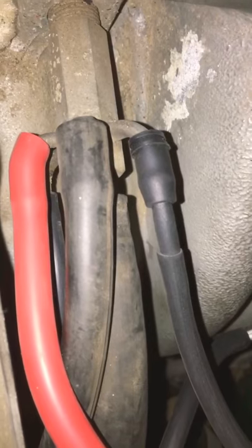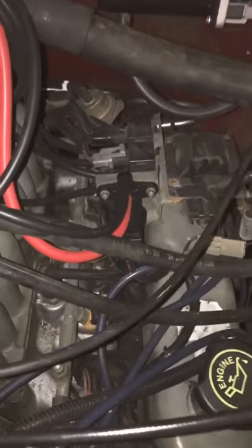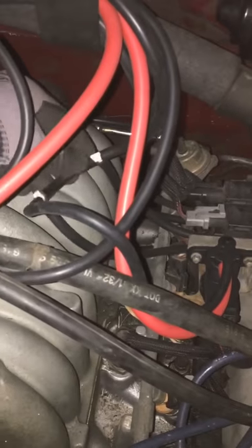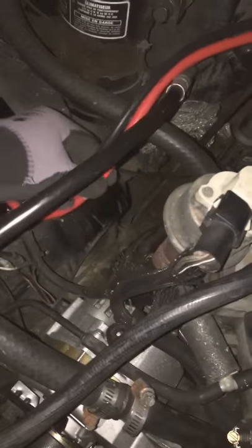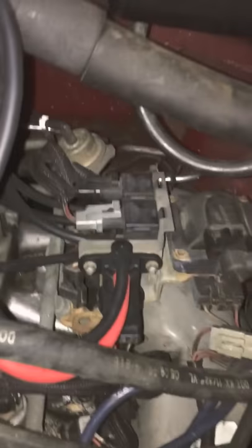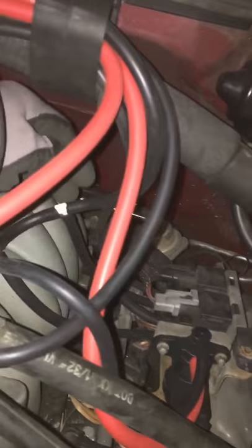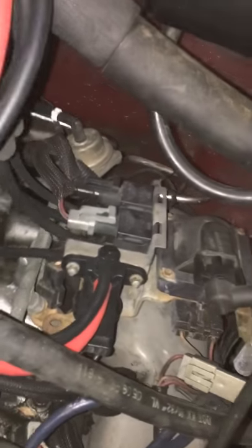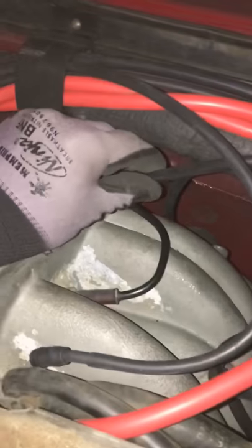That's pretty much it — a quick little rundown. Two T's: bottom ports to your canister. One here going to the top piece, from the EGR to the bottom of the EGR switch. The one down there goes to the top of the second T, connected back behind there. The one on top of the first T goes to the one that's back there.